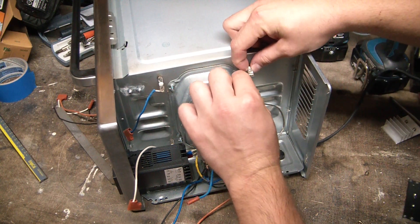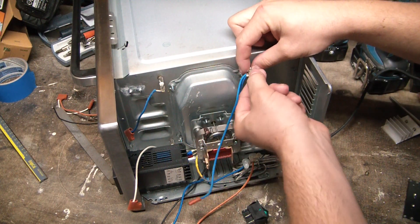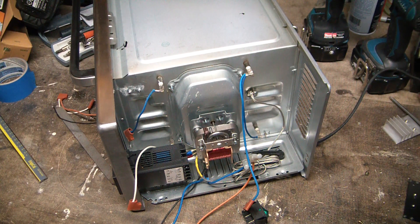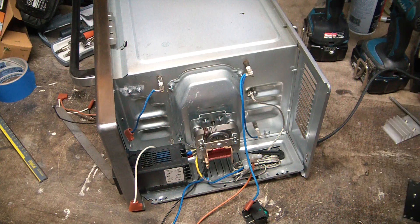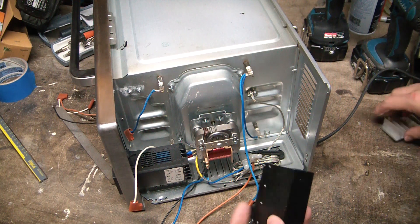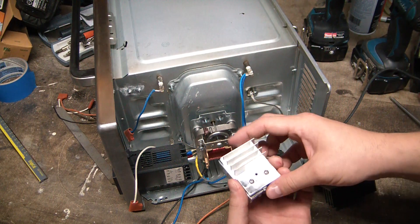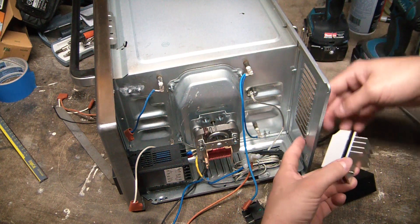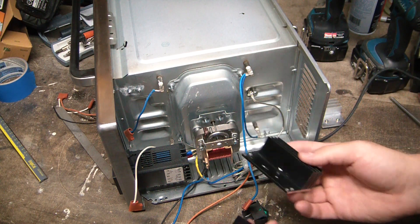The steel should be fine at 700°F with the satanite covering, and hopefully it won't transfer too much heat in. I'll also try to wrap it as best I can in the ceramic fiber blanket. I thought these exterior brackets would remove so I could get a nice even surface to drape the blanket over, but they're welded on — so it's going to make it a bit more of a bear. I might have to chop the blanket into pieces and somehow glue them in with the satanite.